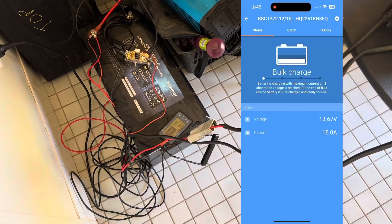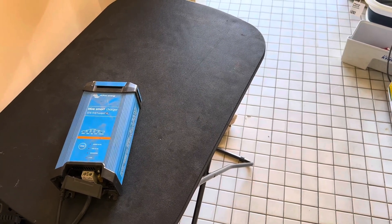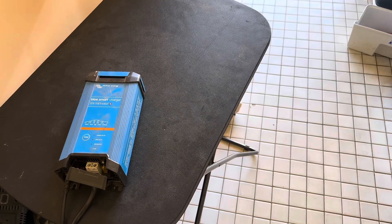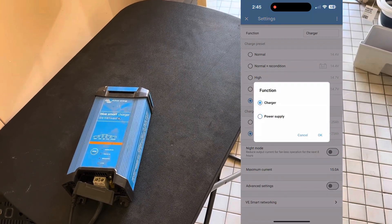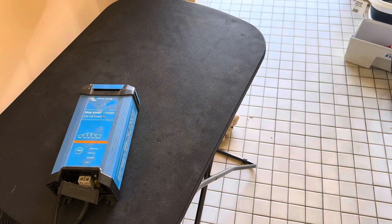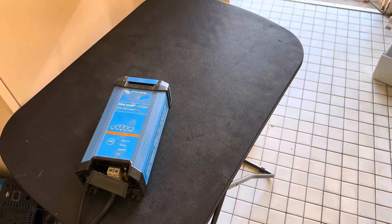At the moment I've got it set to battery, so it's not really going to affect it. But if you had a 12 volt device and it was set to battery mode, it won't actually turn the item on — I haven't found it does any damage. My suggestion would be to disconnect it before you change it over to power supply mode or before you put it on charge mode. Go into settings and change it from charger to 12 volt supply. Then come back to status and it'll show the voltage and amp draw. Your fridge will cycle on and off from time to time, but the charger gives a constant 12 volts and the fridge just turns on and off when it needs power.